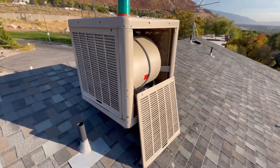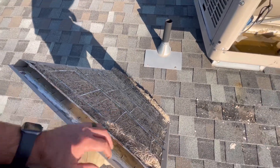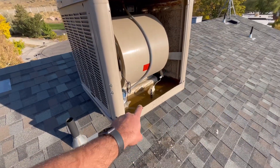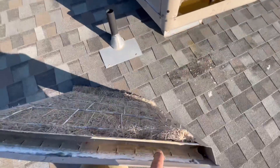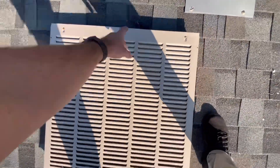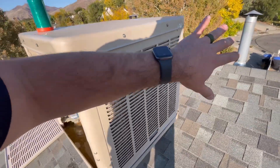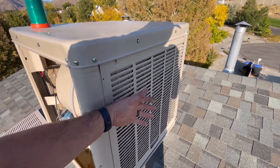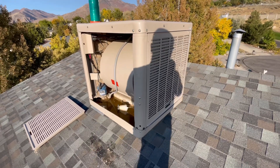These are very basic machines. I've got this one side panel taken off, but basically all it consists of is a pad of some sort. This one is like the straw material, and what it does is it takes water from the bottom and pumps it up through this tube, through these little hoses, fills this channel, and it just soaks this pad with water. Then as soon as you turn that fan on, it sucks all of this evaporative air through these pads, and because the water that's in here — the moisture — is evaporating, that's what causes a cooling effect. And so that's why it's called an evaporative cooler, or more commonly known as a swamp cooler.